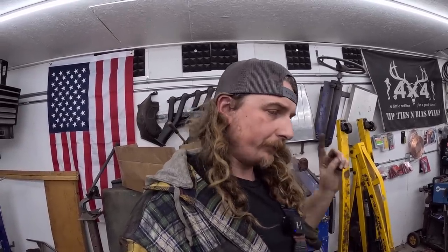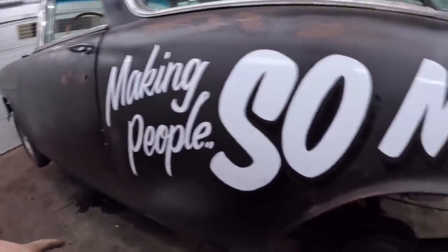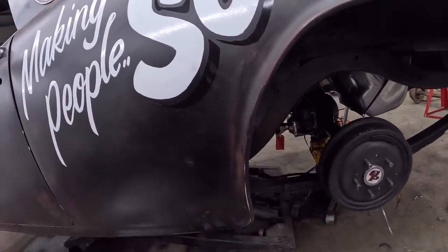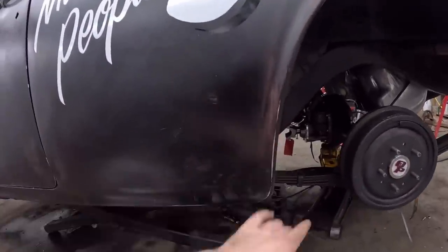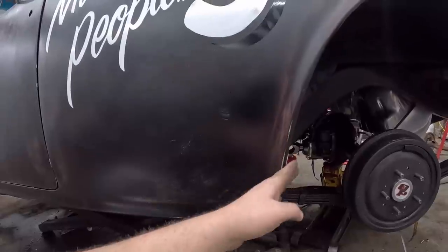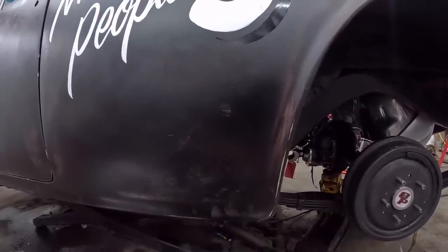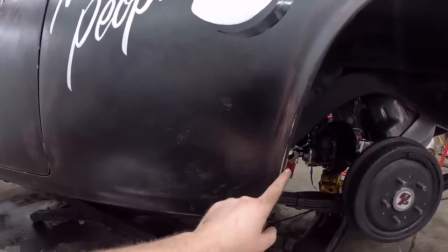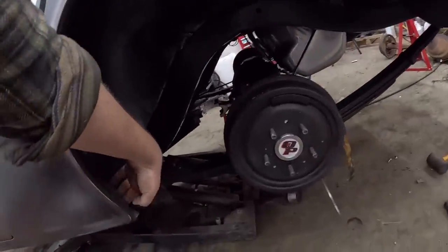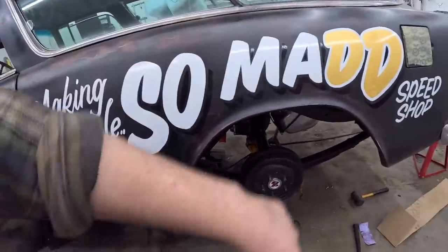These are big tires. The next thing we're running into, these tires will not fit. Well, I mean they will, but with this lip right here. So I'm figuring out the proper way of doing it. If I should cut it at an angle and fold the whole thing in a little, or if I should just cut it right off. We have lots of space. There's that much room before we're hitting the inner tub, so you can really radius them.